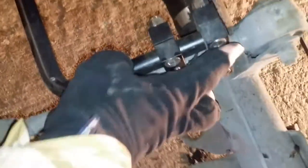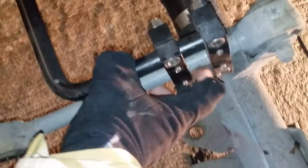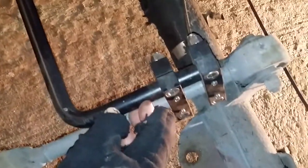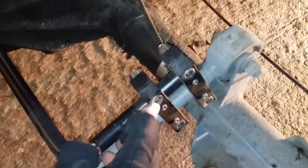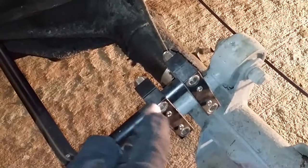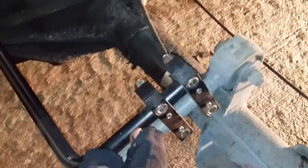In the interim, I've put grub screws in here — I've drilled out the blocks and put grub screws so they bite into the tie rod and also bite into the anti-roll bar. Because what tends to happen is that despite clamping everything up, over time in use these will loosen up and the anti-roll bar will start sliding around, sliding forwards and hitting the cross member or the fuel line. So I've also moved the fuel line to sit underneath the cross member rather than on its back edge, to keep it well out of the way of the anti-roll bar.